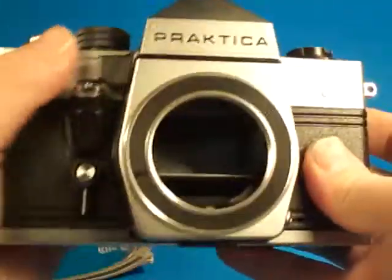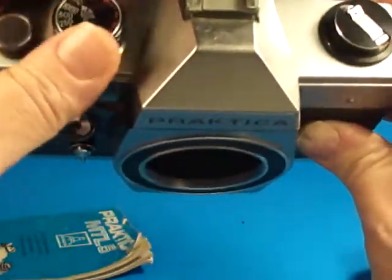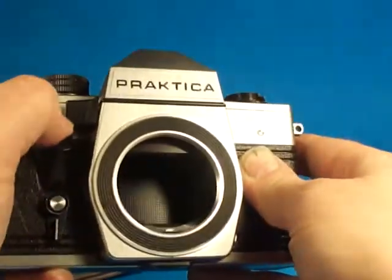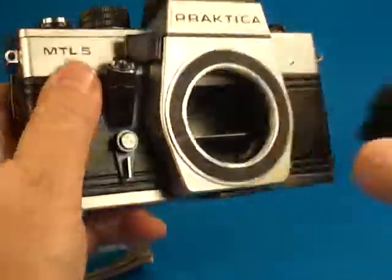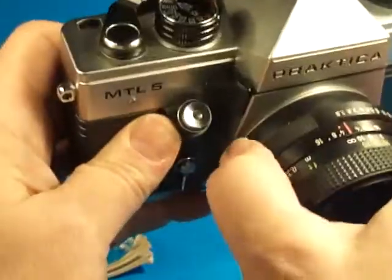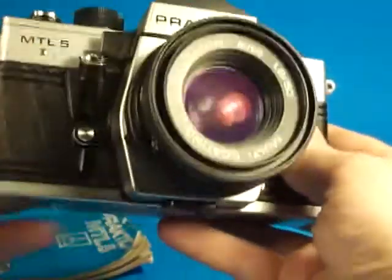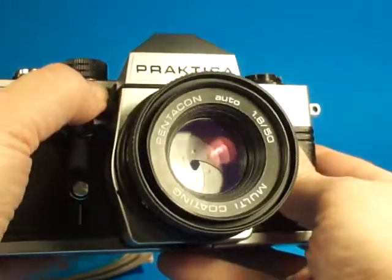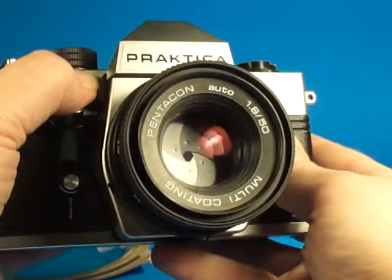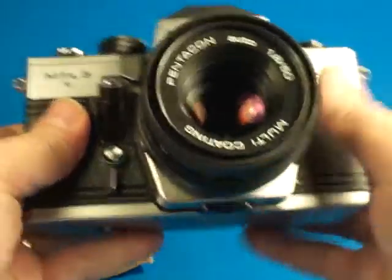And the camera itself — everything seems to work good with that. If we set this on the full one second — very healthy sound. And we screw the lens back in. If we set this on a small f-stop we can see the aperture stops down right. This camera actually requires stop-down metering, so you push that and then work the settings to get the needle aligned in the viewfinder. Fully manual, all mechanical camera. I've verified the self-timer works.